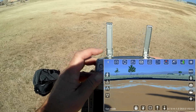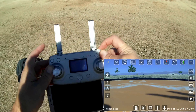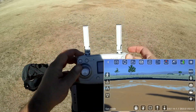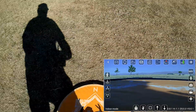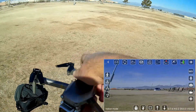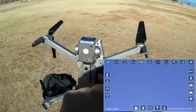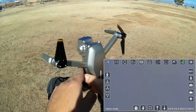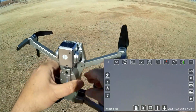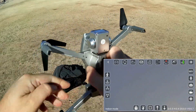The way to do the compass calibration is to hold down the left button — holding the right button just does a gyro calibration. The gyro calibration is completed. Now for the compass calibration: hold down the left button until you hear the beep. The lights are rapidly flashing. Rotate clockwise until you hear a beep. For the second part of the calibration, the red front legs are blinking, so put the nose down and turn again until you hear another beep.